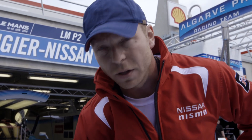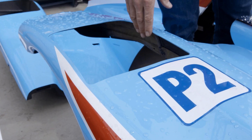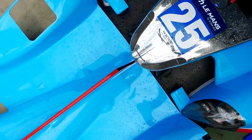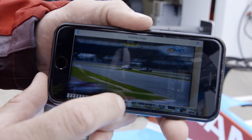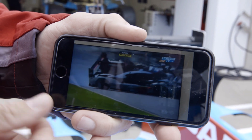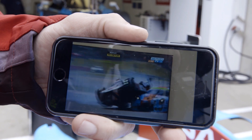The hole on top of the bodywork here, as opposed to having slats, is to try and reduce the air pressure differential, which could potentially cause a flip if the car happened to raise up when it hit a bump. And even this central fin here — the dorsal fin on the bodywork — if the car happens to go sideways in an accident, it actually acts like a sail and prevents the car, or should prevent the car, from barrel rolling and flipping. We've seen that happen a few times where the fin has actually saved the car and stopped it from flipping.